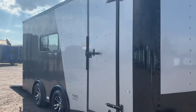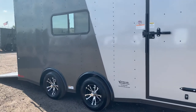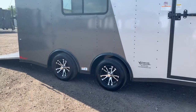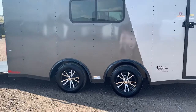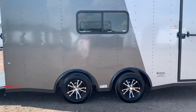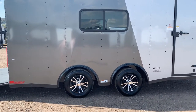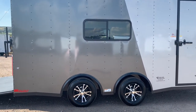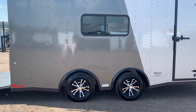The side door has the RV lock and cam bar, so you've got double lock protection there. Two 3,500-pound torsion spread axles — this is as good as it gets in our trailer towing world. It gives you an independent suspension underneath the trailer, so it's going to ride better and tow better. Spreading them apart cuts down on wagging and swaying. We've personally towed one of these through New Mexico in about 70 mile-an-hour wind gusts and it was absolutely amazing.